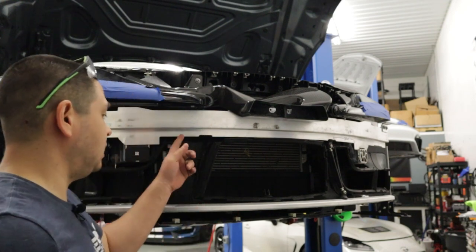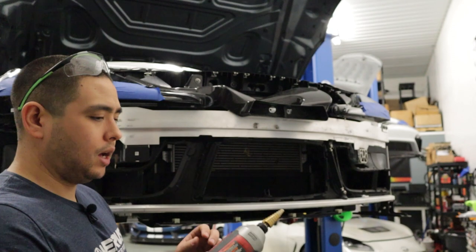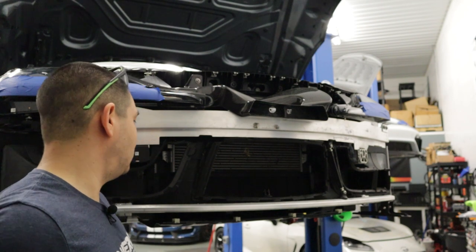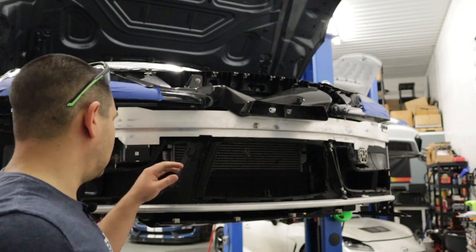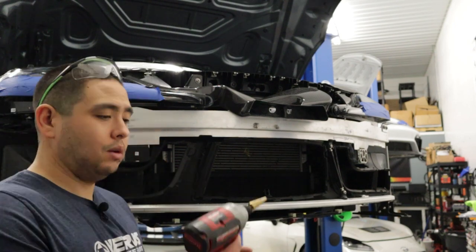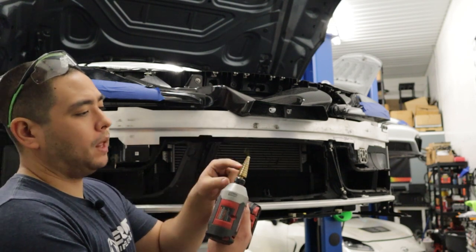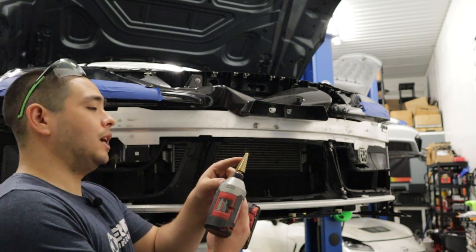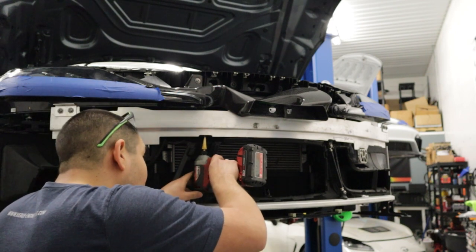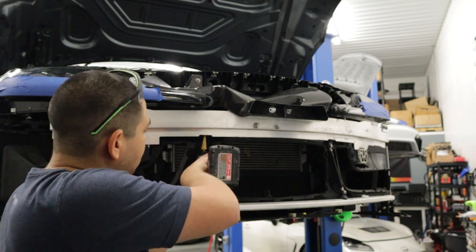To drill this, you obviously have a limited amount of room here. I know this is an impact driver, but removing the pedestrian bar just seemed like something I didn't want to do — I imagine it involves removing the duct and taking out six bolts or something like that on either side. Anyway, use a unibit that has a 3/8ths size step fairly close to the top, which is basically what I'm going to use here, and we're going to go on to that center point mark and drill it.